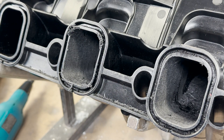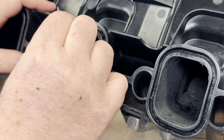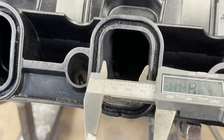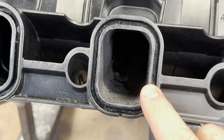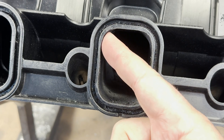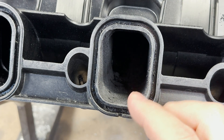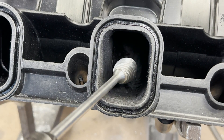I can't make straight lines if I can't see the line, and that's the issue when you have all this fraying in the way. Once you take all that stuff away, we'll measure. I'm just not there yet — not to where I need to be. The lines aren't perfectly straight. They're not going to be perfect from the OEM, but I want to make them as perfect as I can. You can see where I was making the radius — it's big, then it kicks out a little bit here and there, so I need to blend that away. I also did an X pattern when porting — that's to keep it straight.